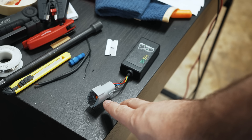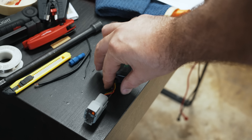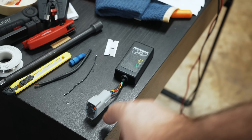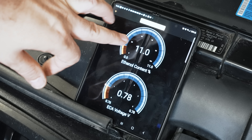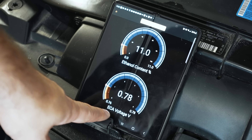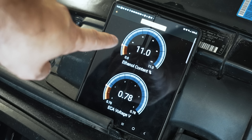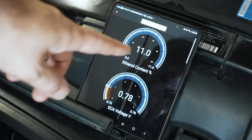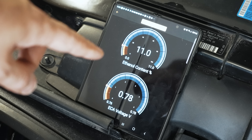It turned out one of the wires was completely dead — the ground wire was not communicating. I redid the wiring, putting a longer wire so it can sit straight. The pin was completely shorted out with no connection between the wire and the pin, so I made my own wire and fixed it. With those fixes, we're now reading 11% ethanol content — it was 12% when I checked with the Spool analyzer. The ECA voltage had been too high, which revealed the wiring issue. I could have emailed them and they would have sent another unit, but I used the info they provided to fix it myself.